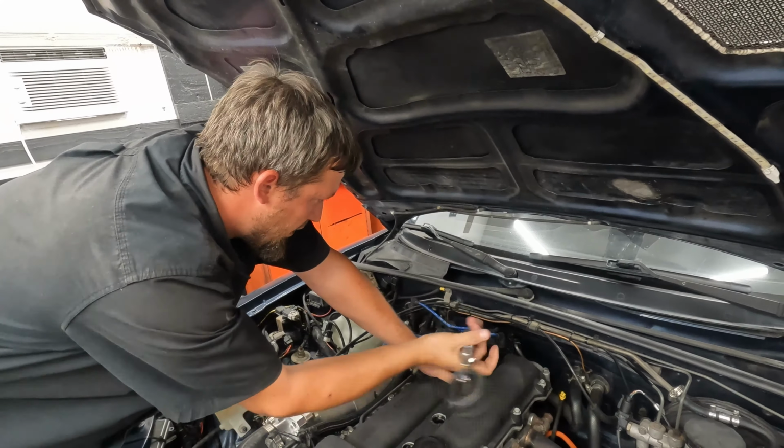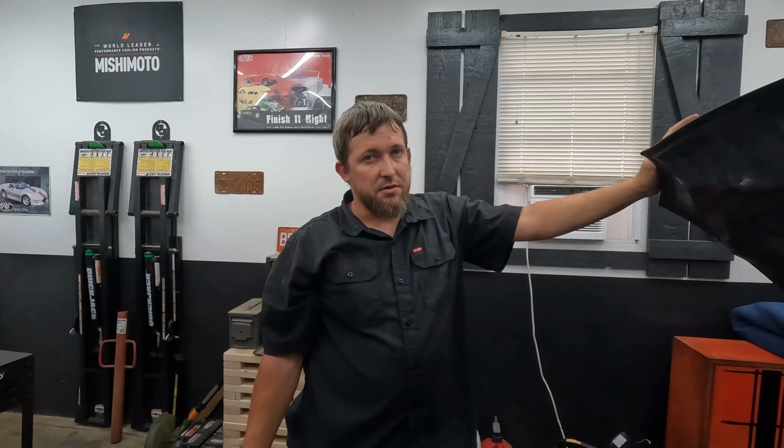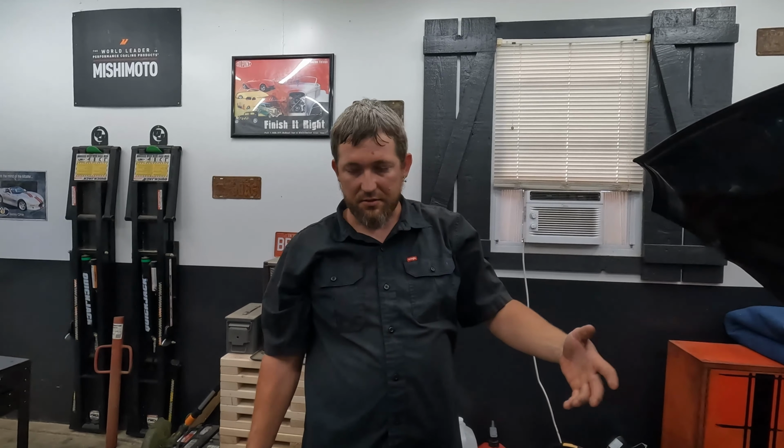So at this point, that's telling me that it probably just needs a rebuild in general. What that number told me is that the head needs rebuilt. So if you're down one and oil doesn't bring this up, you can probably take the head off, have the valves redone, whatnot, put it back on, and you might be all right. If I'm gonna go that far into it, I'm gonna do rings and lower half, because you're taking the whole thing out anyway.